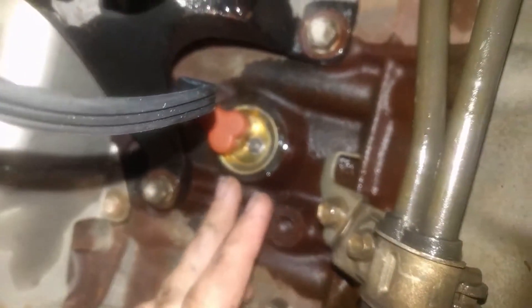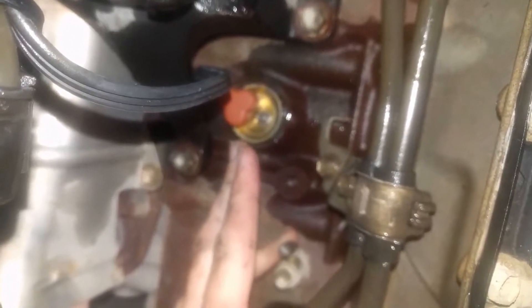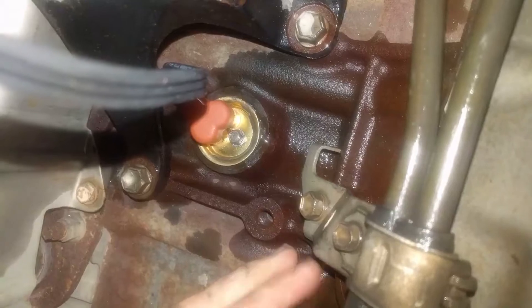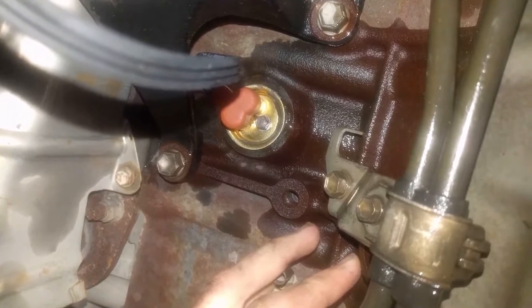I personally don't like this model that much. I also have a Subaru, and that block heater actually threads in — a different design. Anyways, the other block heater I have actually screws in with threads. This one just has that little butterfly thing — kind of weak. You might want to use whatever thread locker or sealant you have. All I had was some RTV black — I don't think it's going to be the best, but whatever you got, you might want to put it on there. Try to make this thing last as long as possible before it starts leaking and you have to redo it.